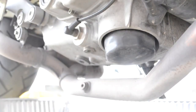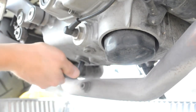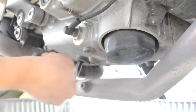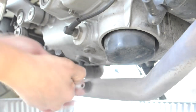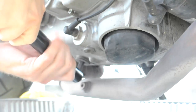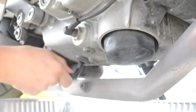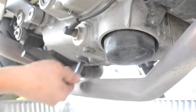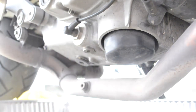Once the motorcycle is heated up, the oil is going to flow nicely. Make sure you don't burn yourself — these aren't that hot, but they do get a little warm. With the 10mm key, give it a little turn. If it's tight, like in my case, use a little pipe to give you extra leverage. And there we go — it's now loose. As soon as we pull this out, we're going to have oil coming out, so don't get too dirty.